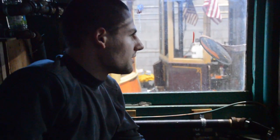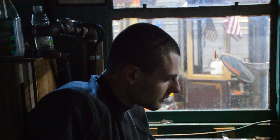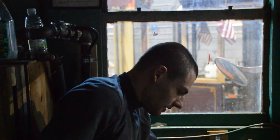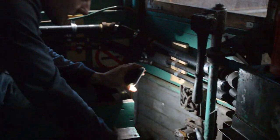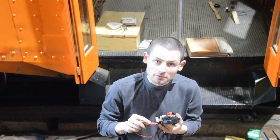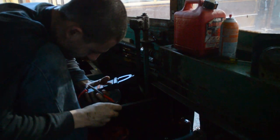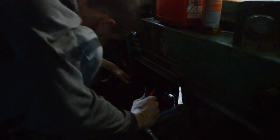Well, we could use it. We have to put the sensing signal wire to the armature, because that's going to say, okay, that's the input — I've got 13 volts, I need more; I've got 15 volts, I need less. And then field will be the output. It'll be all wrong because it's an alternator, but it might sort of kind of work. So we're going to trace the wires to the voltage regulator to make sure what goes to what. We're going to hook armature up to the sensing line on the alternator — that'll be the voltage readout — and then hook the field to the field. It should regulate a bit like a DC generator. We'll find out.